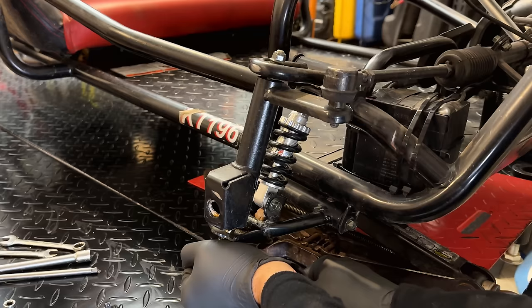Not too bad. The engine sounds good. There's no knocking, no funny noises. So I think the crankshaft swap was a success. Now, we do have another issue, surprisingly. The carb is running the engine too lean. I was having issues getting it to idle, and I was having issues getting it to throttle up. After applying a bit of choke, I could throttle it up, but then I heard the surge. I turned the choke off, and then I could really hear it.